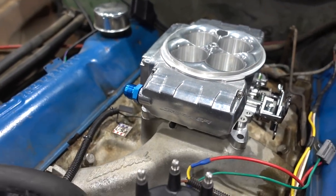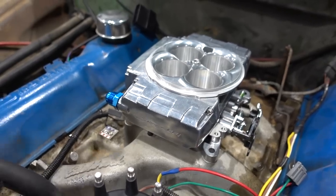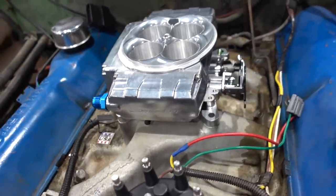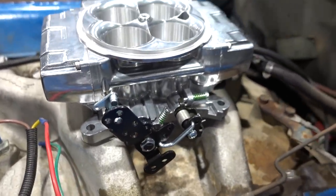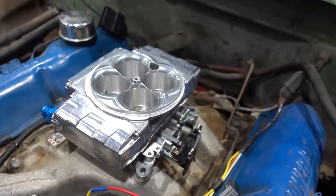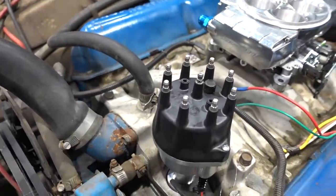So bad plug wires, old car wiring, noisy alternators, that's not going to affect the ECM on this thing this time around. The throttle shaft and plate have been redesigned as far as geometry for a better feel, so that's outstanding. Holley's also got what they're calling an EFI ecosystem. So this thing has a lot of plug and play modules that you can buy as add-ons, for instance, like our HyperSpark distributor and electronic ignition. Overall, this thing has a lot of improved features over something that was already really good.